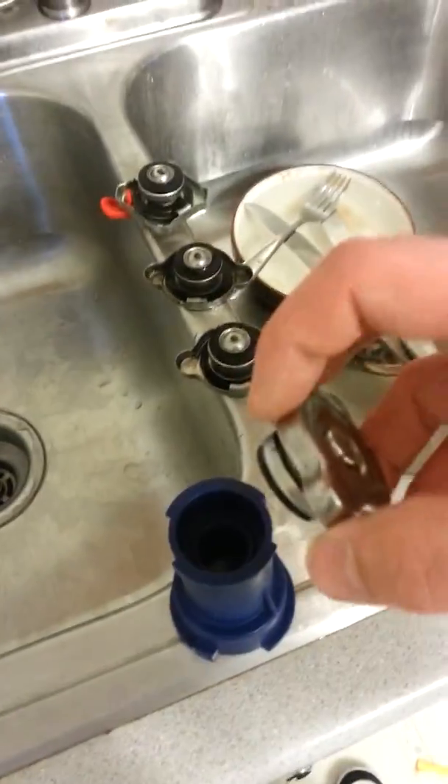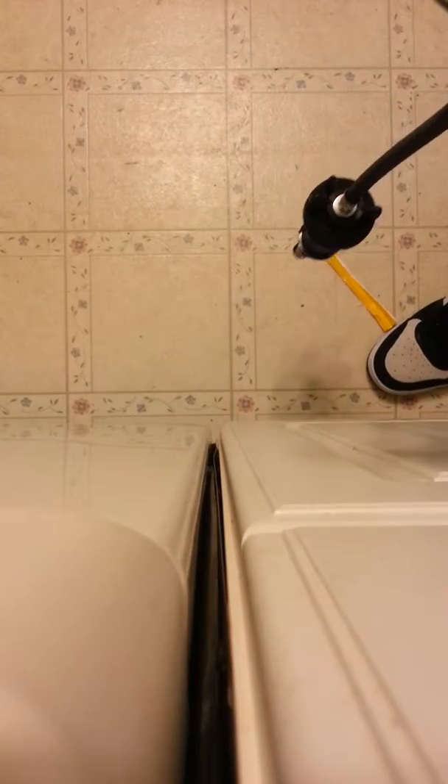So what we'll do is take the radiator cap and twist it onto the adapter, just like you would on your radiator. Get that twisted on there, then connect the other end to the cooling system pressure tester. Make sure that's tight. These radiator caps should hold 13 psi.